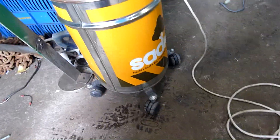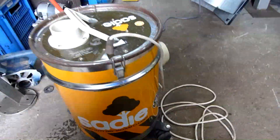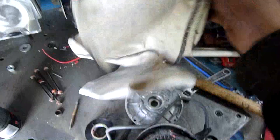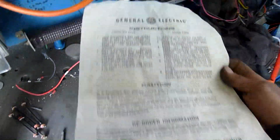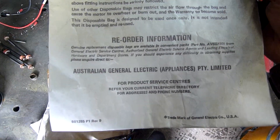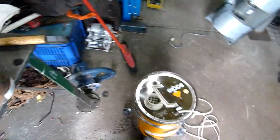Pretty good — nice lightweight shop vac. I'm guessing 25 litre paint tins really were on special when GE started making these, but that's good. Built well, motor's in good condition. It was just a loose wire — one of the field windings was disconnected. It's series wound, so the motor was disconnected. Very good. I'll find an adapter hose for that and we'll just keep it as a general shop vac. There's the inner bag — cleaned up fine, there's no holes in it. And even the paper outer sacrificial bag, the fine dust filter, is in good condition too. I think you can still buy them — I've googled this little unit and there are a few online vacuum cleaner suppliers with bags and things for these. So it's very good — I can buy bags and filters for it. Thanks for watching.